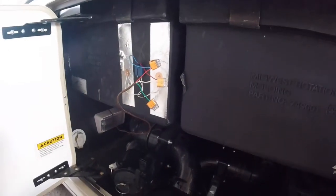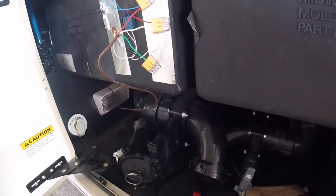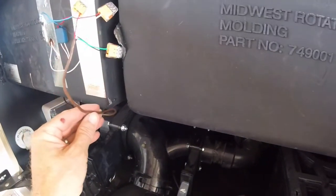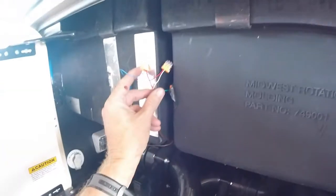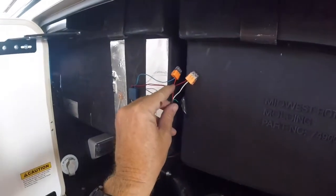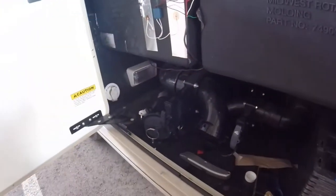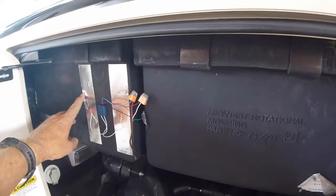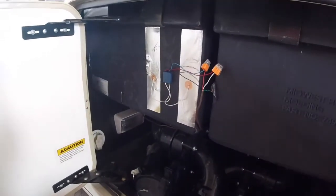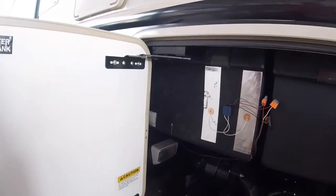Here are the wires run. We've got the strips, the sensor, and we just got it. I like these little push button connectors — we're going to try them for the first time. If this works upstairs before we shore it all up completely, we'll bring these wires over here and tuck them in between the tanks to make it look pretty good. You don't really have to waterproof them since the bay's waterproof, but I don't want to accidentally snag one of these wires and yank the whole thing off when doing a flush. Over on this side we put sensors up on the raised letters of the tank — the instructions say don't worry if they're not perfectly flat, the sensors will still work.